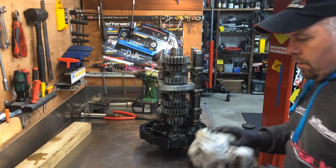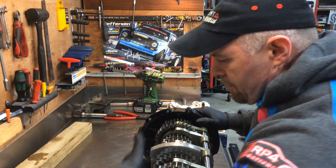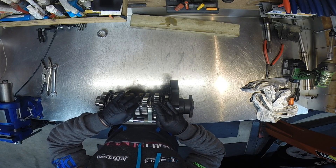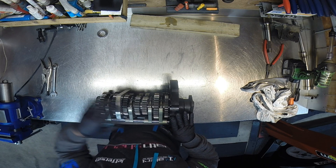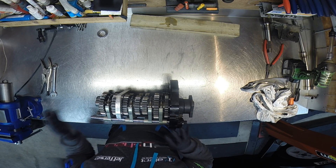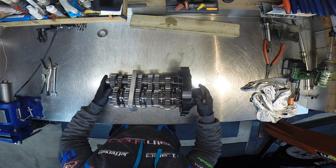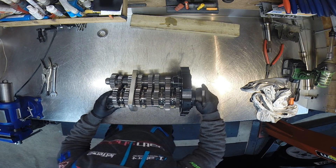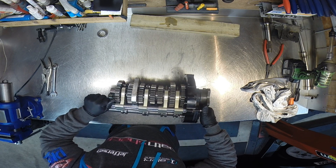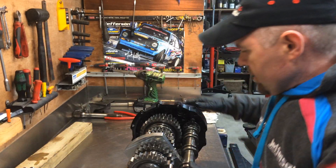Now we have the cluster like we've had before, with the big sandwich plate. We have first gear, second gear, third gear, fourth gear, fifth gear, sixth gear, and reverse gear — that's the full set. If you're pulling any gearbox apart for the first time, take loads of photographs at this point. There's something to reference back to if you've stripped it down and had to wait for parts — a week or two — you're not going to remember where everything goes unless you're very familiar with this particular gearbox. The first thing to do is pull out the two selector rods, which will lift the selectors all off in one go.